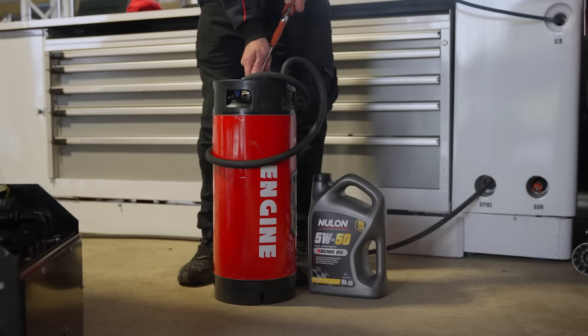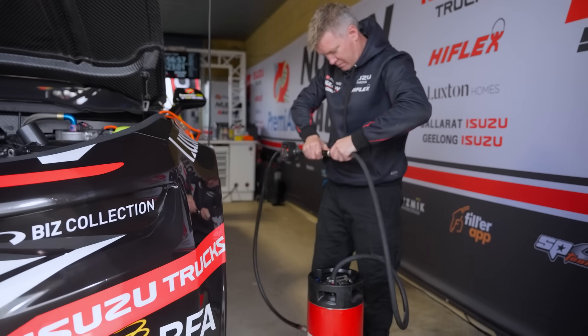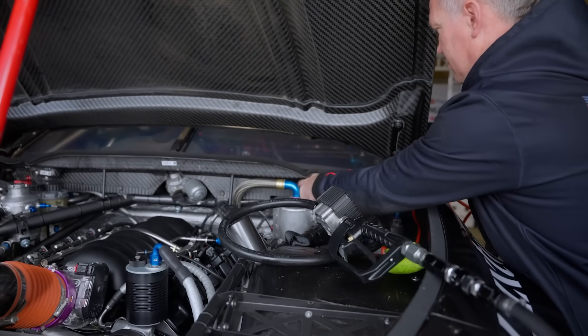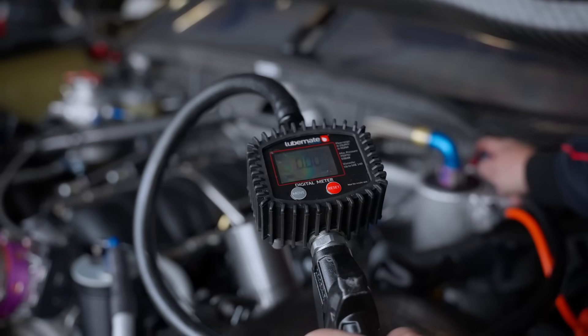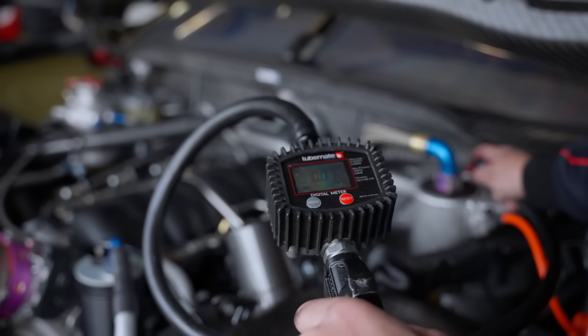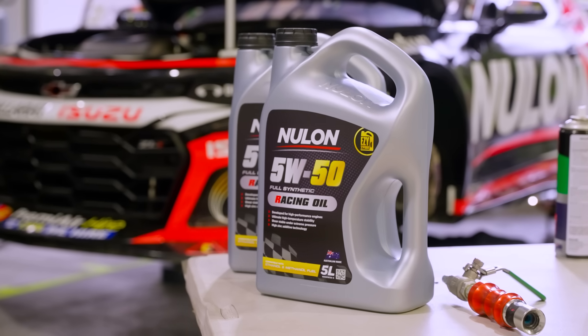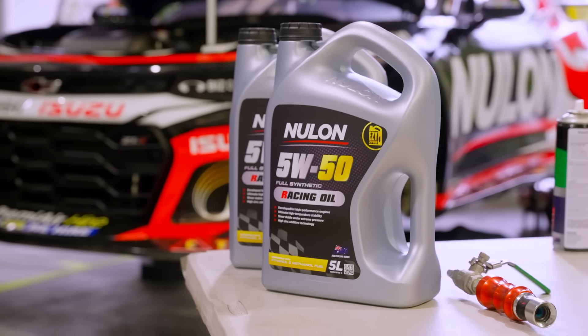When it comes time to refill the engine we use a pressurised canister that has a digital readout on it. Unlike a road car, it's not filled through the rocker cover — we go straight into the top of the oil tank. The oil tank has a sight glass on it. When we run the engine up after the initial service we hold the RPM up over two and a half thousand, which makes the scavenge pump at its best efficiency. We look at the engine oil level at that point. If we switch the engine off, all of that oil will drain out of the tank and back down into the sump, so the only relevant oil level we've got is at two and a half thousand RPM or above, and we're looking at that in a sight glass.